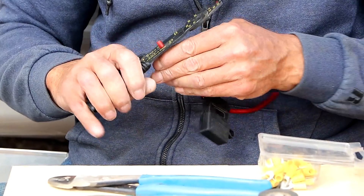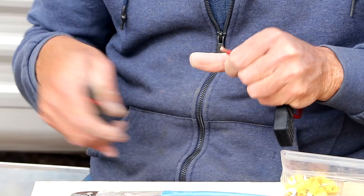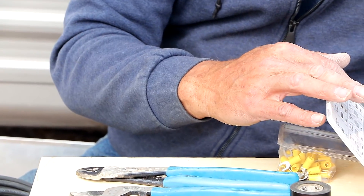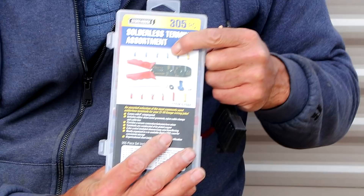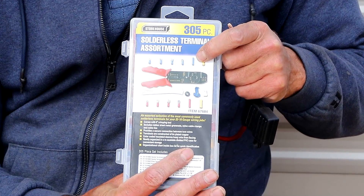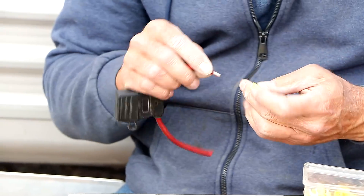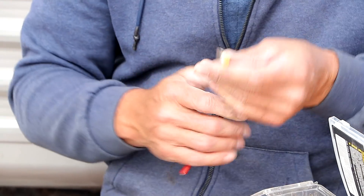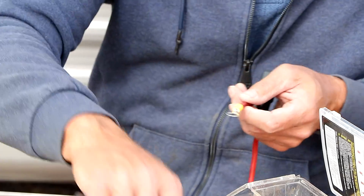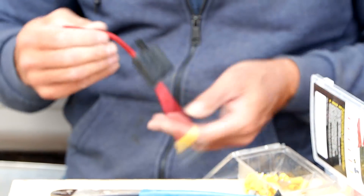It's just as simple as stripping off an end — we're going to strip off an end here. These are just cheap tools you can buy at Walmart for three bucks, and as you can see it actually comes with one of the crimp tools in it, along with all of the connectors and some zip ties. Let's put a lug on here. The wire comes just slightly out the end. I'm going to give this a couple of squeezes. That end would go to your battery.